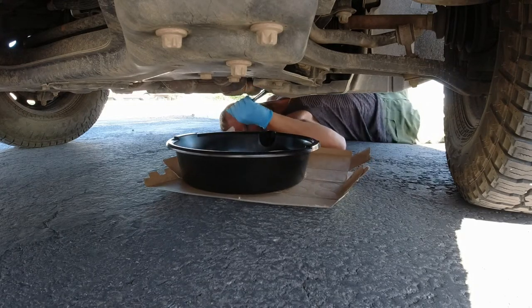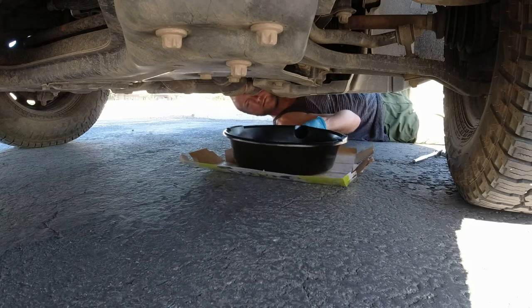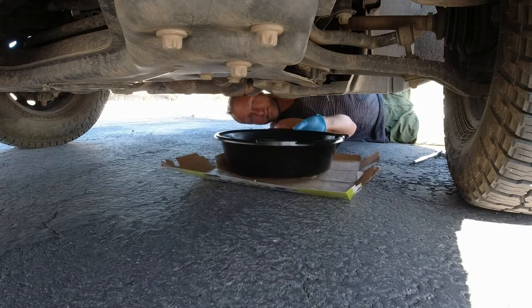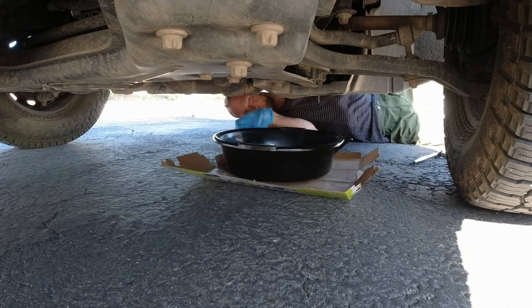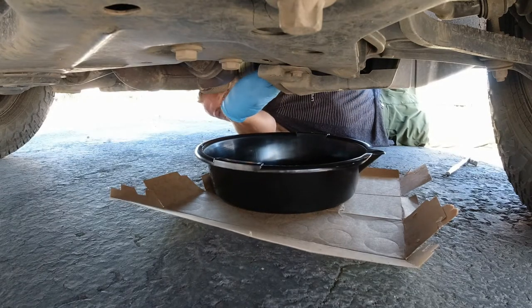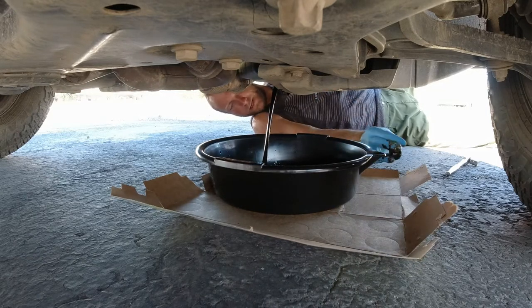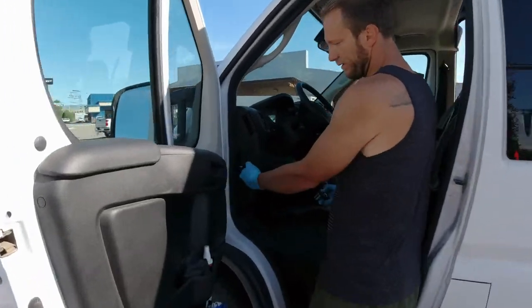This is the hardest part for us — getting that started. Try to be extra careful about lining this up nicely. This is a seven quart drain pan and we have six quarts in there so it gets pretty full. I got my rubber gloves on and then pull out the drain plug — gotta be careful because everything's hot. Put that bolt off to the side and we'll just let it drain for a bit.